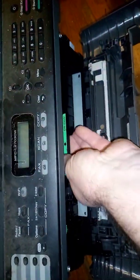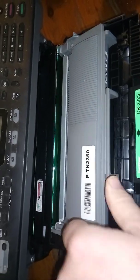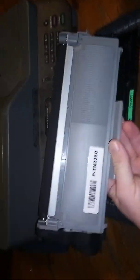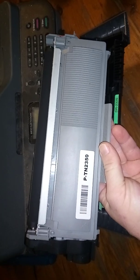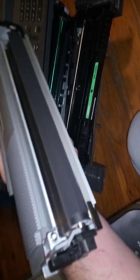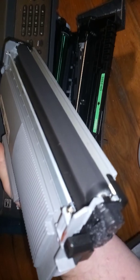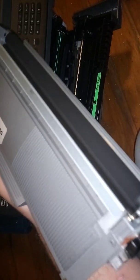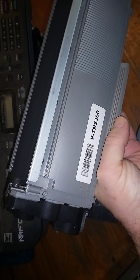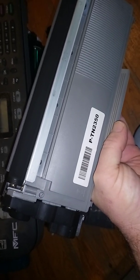There are a few reasons why your machine produces an OB error. The most common cause, believe it or not, is a non-genuine toner cartridge — specifically non-genuine toner cartridges from specific online cartridge selling companies. In Australia there is one major online cartridge selling company, very well known, whose ads pop up on every website.